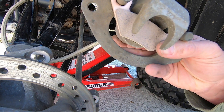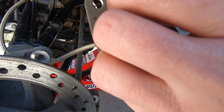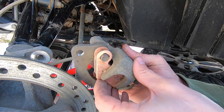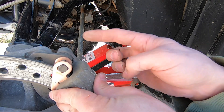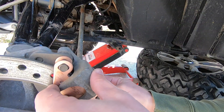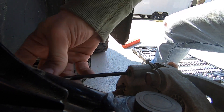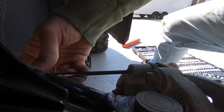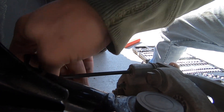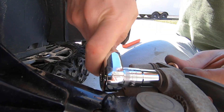There's the first one and the second one — make sure you're putting them pads facing pad. Then it fits and slides right over top. I am going to put these bolts on first and then put my set screw back in. Then take our set screw and put it back in place. That set screw will bottom out at some point, and you just need to make it go to the bottom, but I would not crank on it as hard as you can — just a nice snug fit. There you go. Tighten up these bolts.